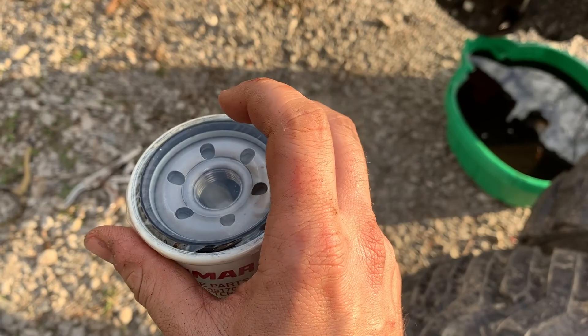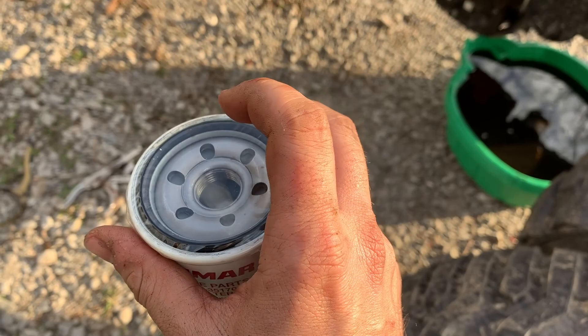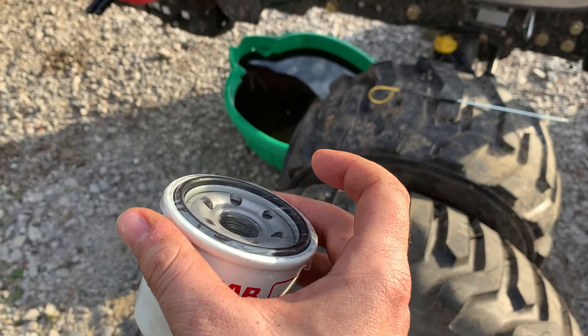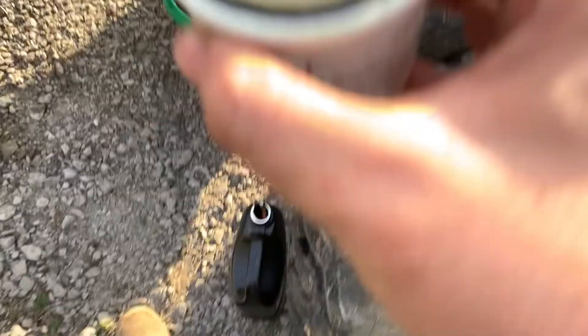The gasket's still in there too, so just pop that off. Probably a good idea to put some oil down in this — it is an oil filter, and since you can just on and off it real quick like a normal car, good to have it pre-charged so you can just slap it on there real quick.